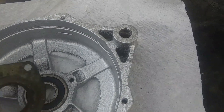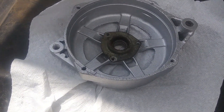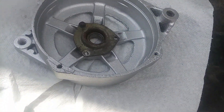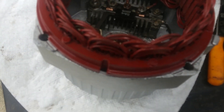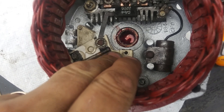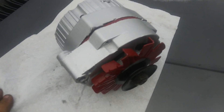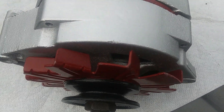I just drove the bearing back into the front housing. I'm going to put the bearing holder in. I've got a new bolt for the one that was broken. I'll put these in and then start assembling the back half where the voltage regulator and everything is. I've got the housing painted, the diode bridge all in, and the voltage regulator getting ready. If you notice, the brushes are put in the holder with the spring with a paper clip holding them in place — that paper clip gets removed once it's put together. Here's the final assembled product: alternator taken apart, all the contacts cleaned and checked, brushes all look good. I'm going to mount this in the car and wire it up.